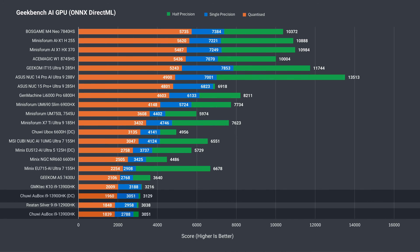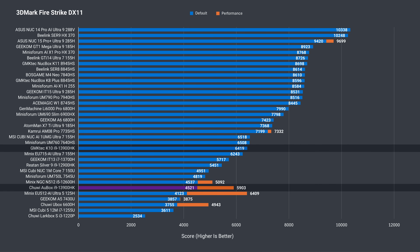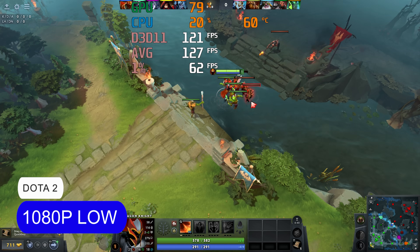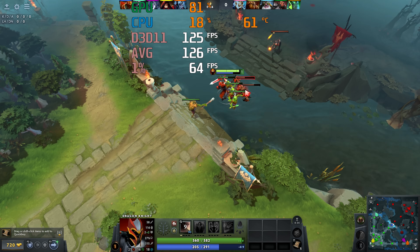Intel's Iris Xe graphics has dismal AI GPU capabilities and is easily beaten by a Ryzen 6600H. With just one stick of RAM, the 13900HK also does poorly in the Fire Strike graphics test. A second one brings it to a more mid-range offering, though the GMK-Tech mini with DDR5 does even better. DX12 TimeSpy performance is low either way, and the Steel Nomad Lite benchmark shows this chip is not really enough for gaming off the iGPU unless it's simpler esports titles. All games are tested with two sticks, as that's really the only way to go for gaming on this CPU.